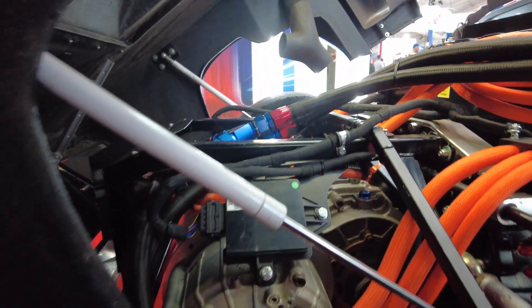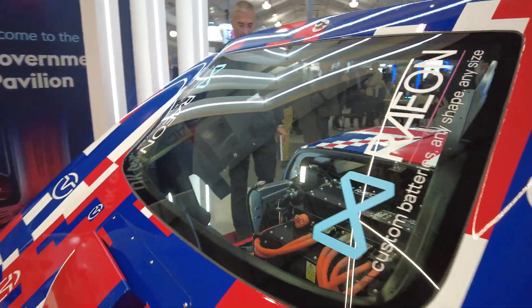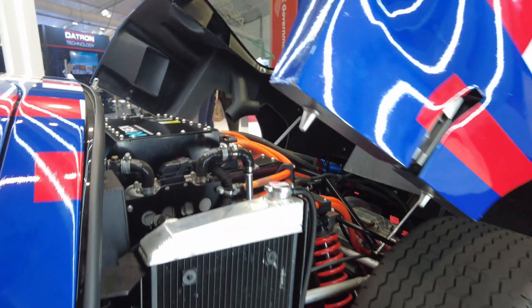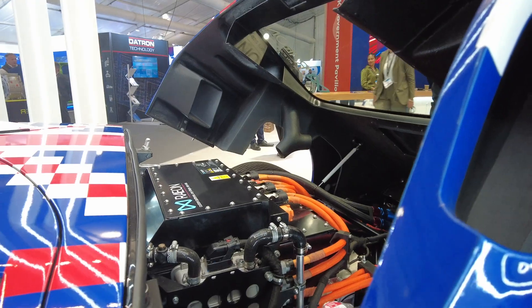I've commandeered Tony Fong, Head of Engineering. The GT40 has two motors at the rear driving through a parallel-axis transmission going through an LSD — a good old-fashioned LSD. The car is capable of 800 horsepower. It has a single battery pack, upgraded from three separate packs into one to reduce weight and improve balance. There are two radiators — I can see them — one for battery cooling and one on the side.